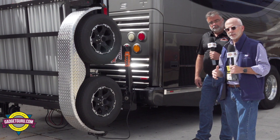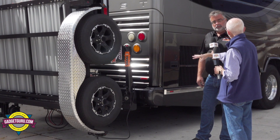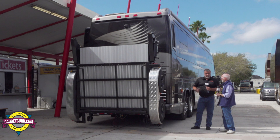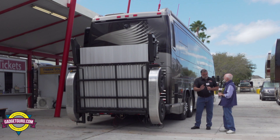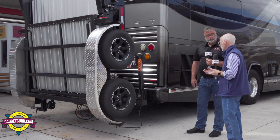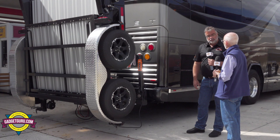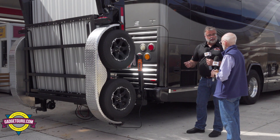I'm not a chassis guy or an expert on this. Do you feel a Prevost or large Class A motorhome can handle this while parked with all this off the ground? I believe it can. I don't have access to the engineering data for Class A coach frames — that's something the consumer will have to confirm with the coach manufacturer. That's a 20,000-pound hitch on there, connected in three places. At five miles an hour, I don't think there's any issue at all. When I tow, I flat tow a Jeep. I have Air Force One connected on the brakes and the electrical. The brakes are all electric brakes on all four wheels, and we use a standard seven-wire RV plug, which handles the brakes and all the lights, and also trickle charges the battery in the trailer.